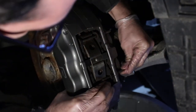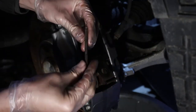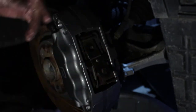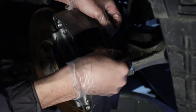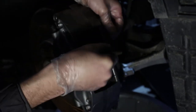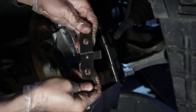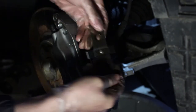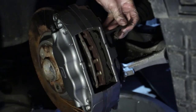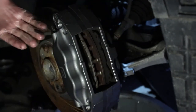Loosen up the bracket. Once one pin is out, put it aside and remove the bracket — it will slide off easily as soon as you take one pin out. The bracket has tensile force and just pushes the pads down where they're supposed to be. Take out the second pin and that's the first stage all done.